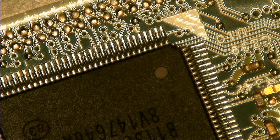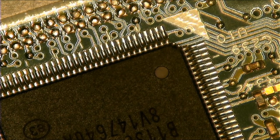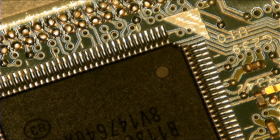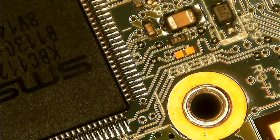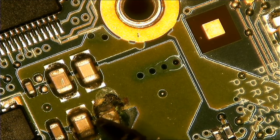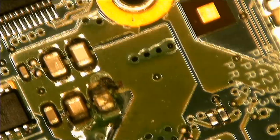When I plug in the charger, I'm not getting any charging lights. The laptop is not charging the battery and it's not turning on at all. This makes me believe the problem is this capacitor, which is linked with the 3.3V section.